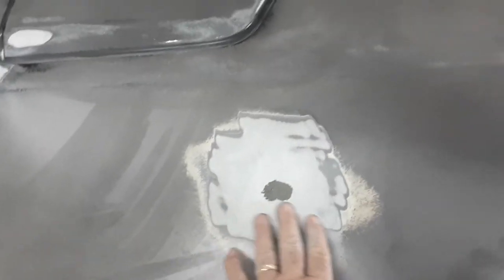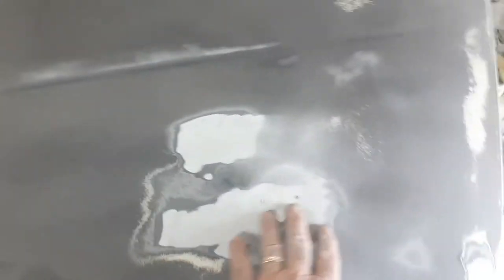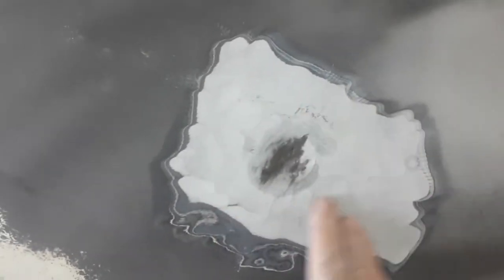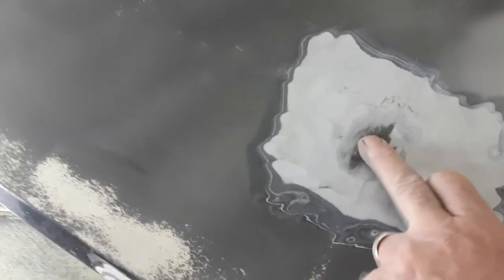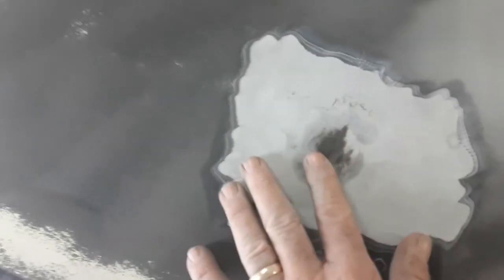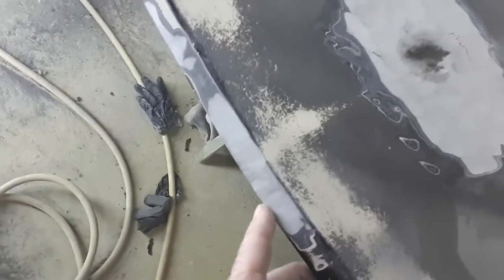I just DA'd the whole hood flat down with 40 grit, then I took my flap wheel and dug out all the areas where it's cracked, right down into the fiberglass. This front part here is gel coat — fiberglass with talc in it — and you can see the cloth right there. The crack here was only into the gel coat so I took it out. I'll build this up with fiberglass, repair all these holes with fiberglass — the corners are both chipped, all four of them, and there's a crack in the front. All that fiberglass damage gets repaired before I start doing any body work.